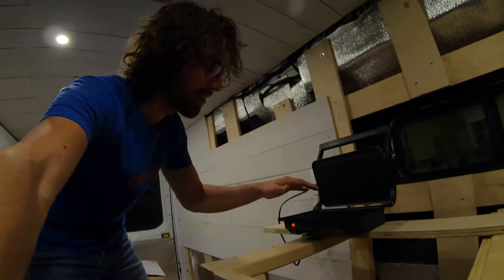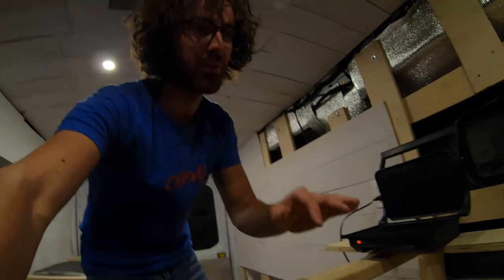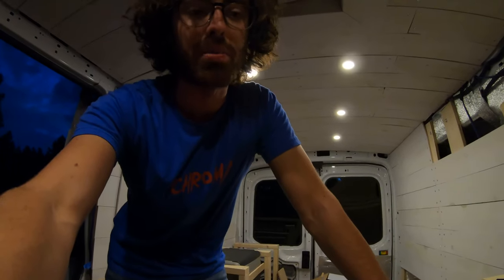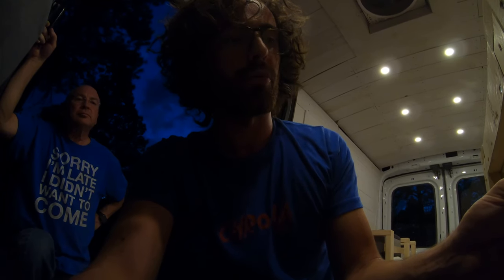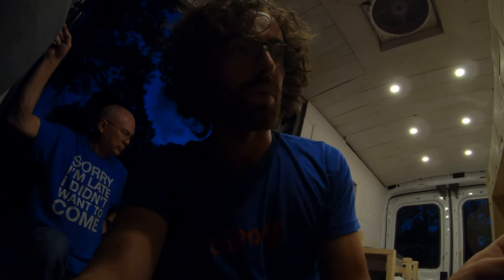So we plugged in our trusty panini maker, which is the only way I've had to drain the batteries significantly because they're always fully charged, and when they're fully charged the sources of power stop pulling. When we plugged in the panini maker, we started pulling the full 30 amps through the plug, which is pretty amazing. That might be compensating completely for the panini maker — we're using 733 watts, which means we're pulling at least 300 to 400 watts through the shore power because it's compensating for how much we're using. So if we unplug the shore power, we'll see how much we're pulling after that.